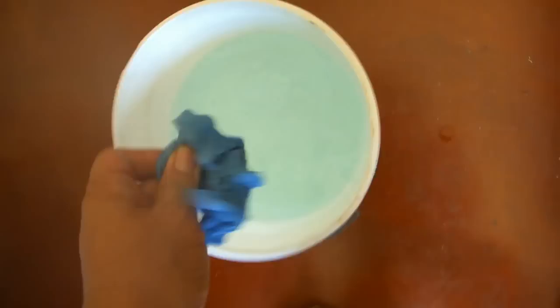That's pretty good. Make sure that when you do this, you get under that ridge below. Make absolutely certain there's nothing under there either. Now you can switch to some warm water and Dawn, and basically repeat the process. Use a dry paper towel and go over the inside of the cylinder to remove any remaining water. Be absolutely certain it comes out completely clean.